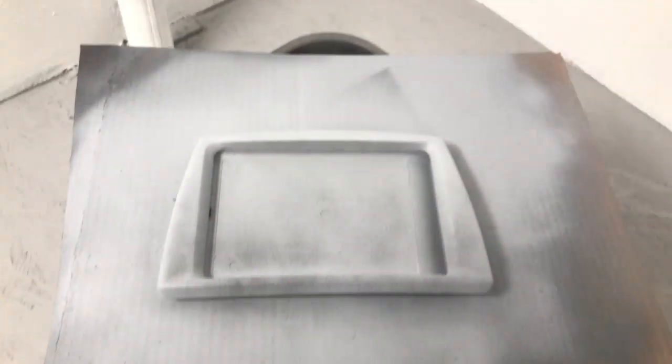Here's a little tip for you guys. Right now it's still wet from the fog coat I put on there. While it's still wet, we're gonna hit it with a little bit of black — it's called a guide coat. So basically what the black does is become a guide coat. When I come back and sand it with 400 grit, I sand it until it's all gray, all smooth primer. Any low spots that are there are going to remain black — that's what it's for. Once you do that, the paint jobs come out smooth. That's gonna wrap up the video for today, man. Thank you guys for watching, once again appreciate it, catch us next time.